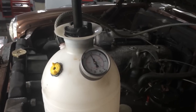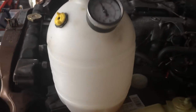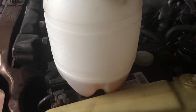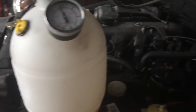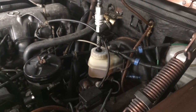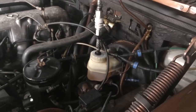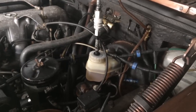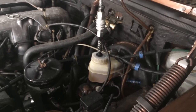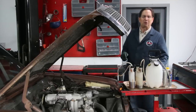I'll keep checking back at the pressure tank to make sure it's holding pressure. You also don't want to let it run empty or you'll put air back into the system. So far it's moving just fine into the master cylinder reservoir and we're almost done. We can actually finish this job with the pressure bleeder and two capture tanks in less than 20 minutes — for this one it took us about 15 minutes.